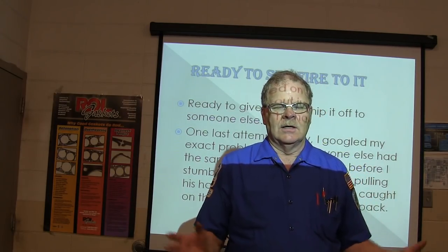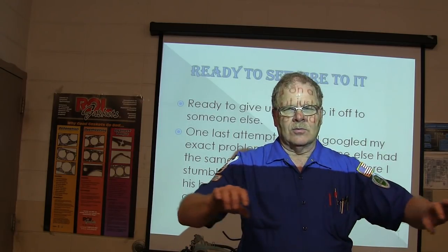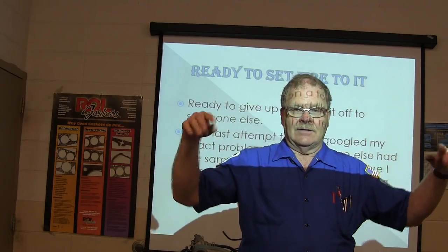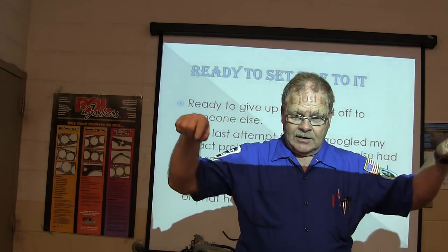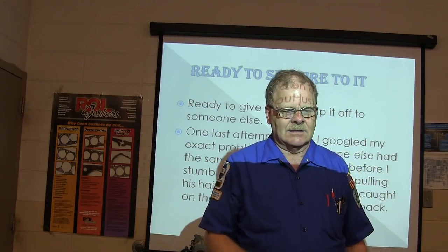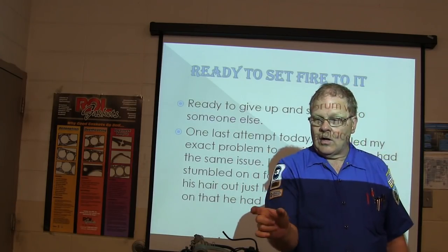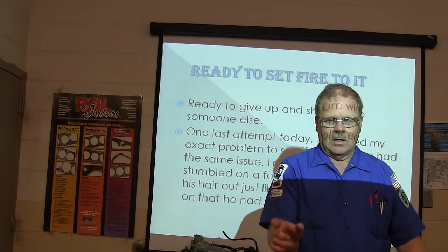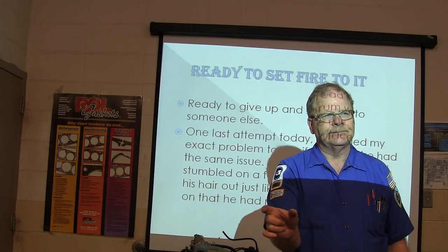Now, you've got to remember, this Jeep has a coil rail on it. It's like coil packs, except it's a long rail, about that long. It basically has the little boots on the plunger, so that they go right down the spark plug holes, and then you put bolts in there and bolt it down. Now, let me ask you this. If you're standing here looking at the engine, you've got a coil that you can see molded in there, and another coil, and another coil. Now, which two cylinders does that front coil fire, you think?